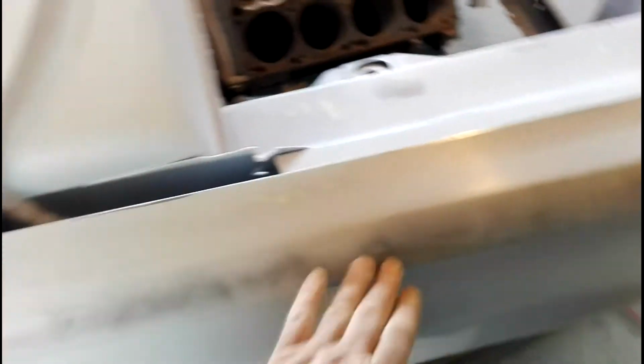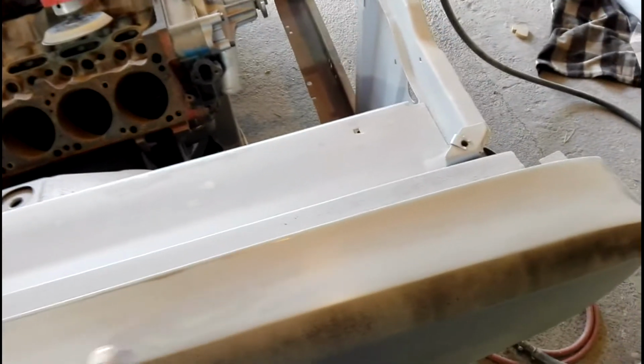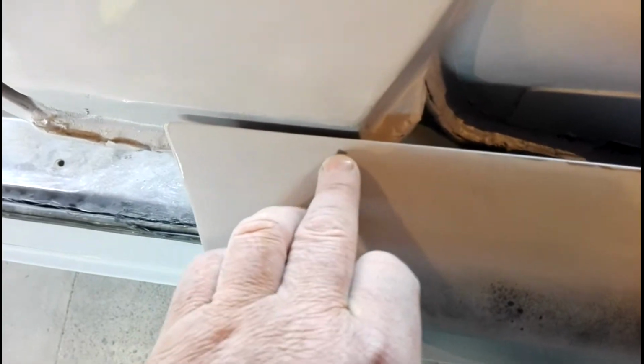Now what I've done is I've rubbed the top of this guard back, well, not here, but across this piece, trying to flatten it out. Then I guide coated it a few minutes ago, and I went back through here and gave it another rub. So I guide coated it just before I started getting through into the steel. But when you have a look here now, you can see that I've come into steel, and in spots around it there are little black speckles from the guide coat. It's very, very light in here, not deep, just very light speckles. So obviously it needs a wee bit more material in here.